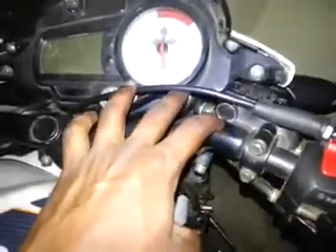If the airlock is somewhere in between the system — especially when you have an ABS model — you have a lot of area where air can accumulate and you'll end up with a soft brake. In that case, you have to do a complete bleeding. Also, if you find that the color of the brake fluid is not proper — it's a creamish or whitish color — that means your brake fluid is spoiled and you have to change the entire system fluid.